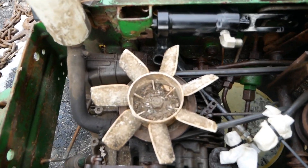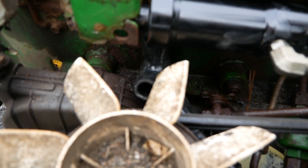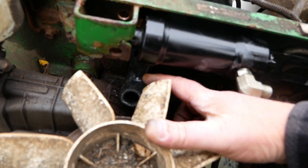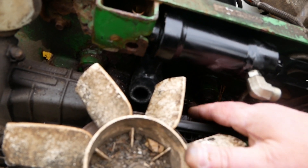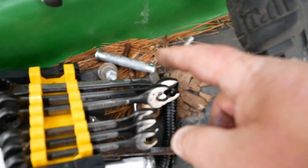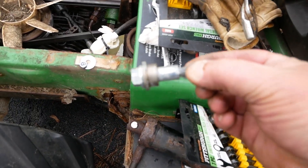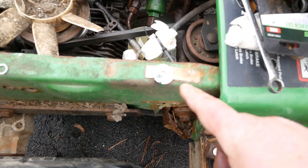All right, YouTube, I'm back. I'm putting the lift ram in. What I had to do was slit that elbow the whole way because it was double-chambered. I don't know if this is going to work or not. I got to get the clevis pin in here, which I've never-seized. And then here's the shoulder bolt with the brass bushing, and then the new nut and washer.